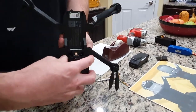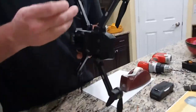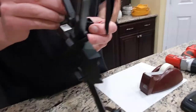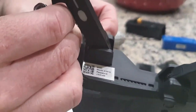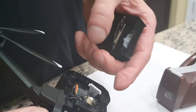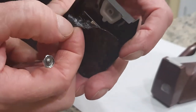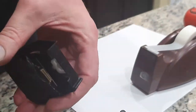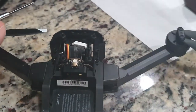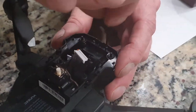We'll notice that it's hooked by a wire. This is actually the GPS module inside of here. I'm going to take my screwdriver and kind of pry the connector out of the board. There's the board. There was actually a piece of copper shielding — I just bent that back a little so I could get to the connector and pop it out. There's the connector. Later on we're going to have to squeeze that connector back in when we put it back together. When we get underneath, there's going to be more screws under here.